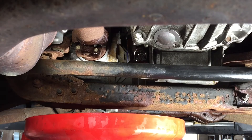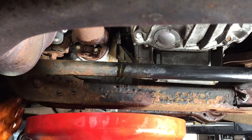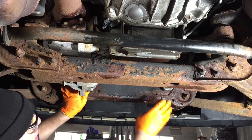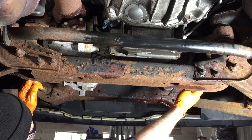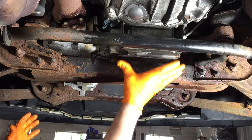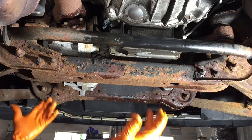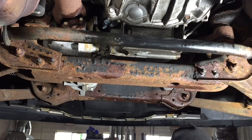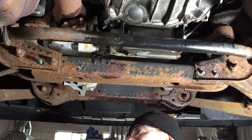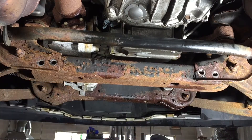As I'm letting it drain, I'm preparing for the next steps. We're going to pull down this crossmember, disconnect the driveshaft, disconnect the power steering rack, unbolt the axles, and then lower the diff out of there — only because I want to pull the oil pan down unobstructed since I'm putting in a new oil pump. Using the electric impact, I'm able to get the crossmember bolts out pretty easily; they came out with no major issues, then you just pry that crossmember down.